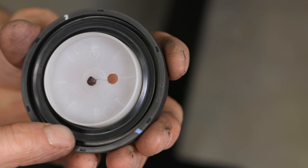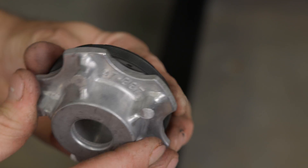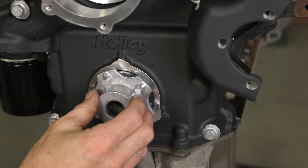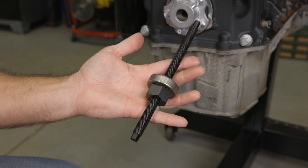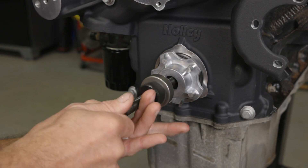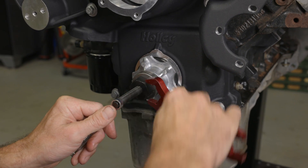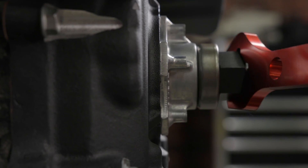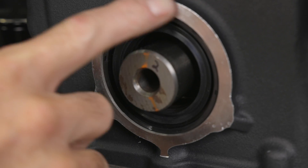A new crankshaft seal and installation tool is included with the kit. The seal needs to be installed with the double rubber lip facing towards the install tool. Apply some rubber-compatible grease to the seal and place it on the tool, then place the seal and tool on the front of the timing cover. You'll need to rent or purchase a dampener install tool from most automotive parts stores. Thread the install tool onto the crankshaft by hand, then use a wrench to tighten the nut, paying close attention to keep the seal square with the timing cover. Continue tightening until the installation tool bottoms out, then back it out and verify that the seal is evenly recessed just below the face of the timing cover.